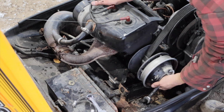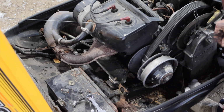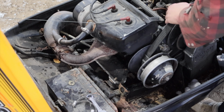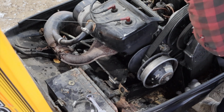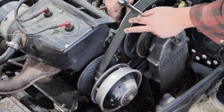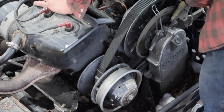So I loosened all the engine mounts and I was able to move the engine over just a little bit. The belt looks a little bit happier where it's sitting now, so what we're going to do next is just tighten it down where it sits, and I'm looking at the secondary clutch. It needs some parts. There's a washer that's missing, or a plastic slider or whatever it is that's missing entirely. Can you see up here? So in behind here there's some plastic dinguses, I'll show you in a second, that are missing from one of the 3 contact points, so that's going to cause me some issues in a little bit when I go to ride it, but what do I know?